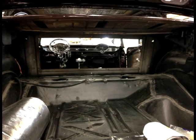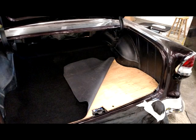The trunk itself was a basic trunk. This trunk also had a spare tire cut out for it in there, which was never removed at the time. What we ended up doing, we installed the sound deadener first. We also took a sheet of 1/2-inch plywood and made a hard surface that smoothed out the trunk floor for him. This way it's actually removable. He still has access to his spare trunk spot